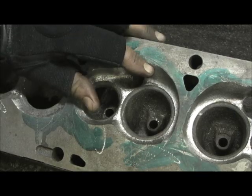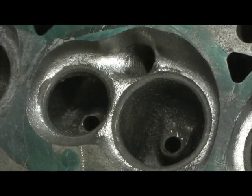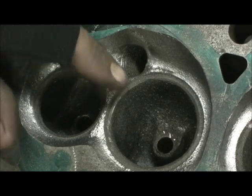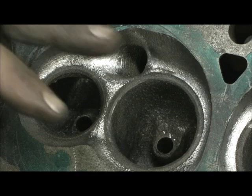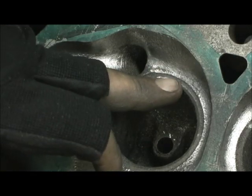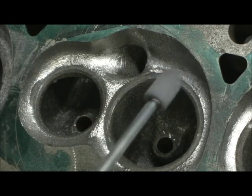The rough grinding with the metal burrs is now over. If you look here — I'm going to try to zoom in — you're going to see a ring ridge right here. Although I don't feel it, I do feel a little bit of an edge. What we're going to do is take the stone and go around here. This is really sensitive; all you're doing is a polish mode. You're going to knock the edge and get it level. You're still going to have a little bit of gap between what was the seat — a very little gap. Watch what I'm doing here, very critical.